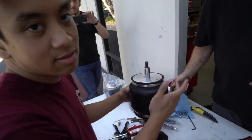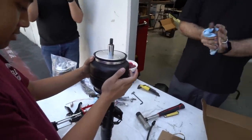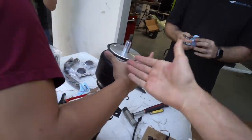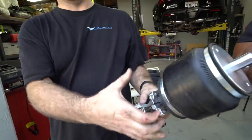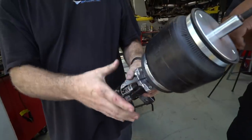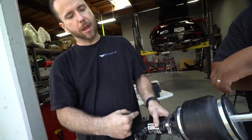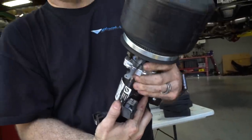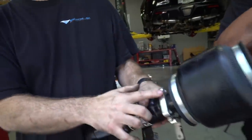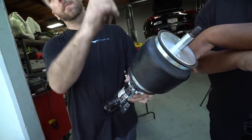So you pretty much took the whole entire spring off, and then with it cleared up you just dropped the bag on top. They can show on the next one - this is a clamp that they have to spread to get it over the strut body because the inside of the clamp is the exact same diameter as the outside of the body. So they spread it, slide it over, and once they position the bag where they want the fitting to come down, they slide the clamp up to the bottom side of the bag, rotate it over, and bolt it on to the bottom, then tighten to clamp it as extra security so it can't come off.